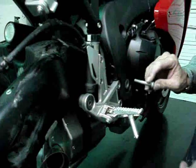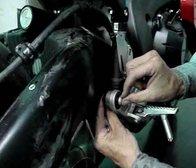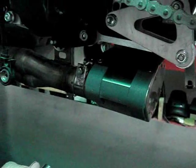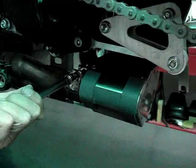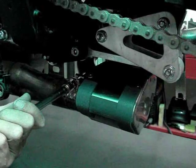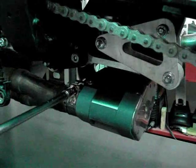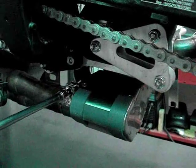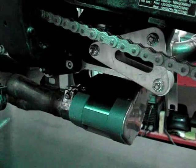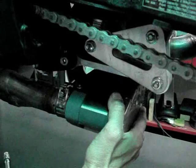Once you've tightened the bolts carefully, we're just going to put this bolt back through the stock bolt and through the bracket on the back, and let it rest there. Now we're going to tighten up the muffler clamp — this is a 10mm socket. You'll find that the clamp tightens up quite easily as it takes up the slack, then goes a little bit tight as it starts to crush the tube. But once it goes tight, you still need to crank it down and make sure it's firmly attached. If you have a torque wrench, the torque setting is 25 foot-pounds, which is pretty tight. After you've tightened the bolt, just grab the muffler and make sure you don't feel any movement to confirm the clamp is tight.